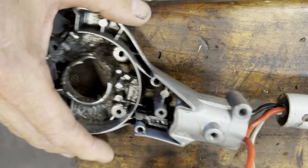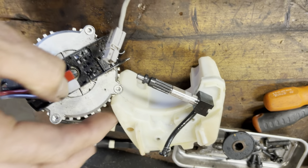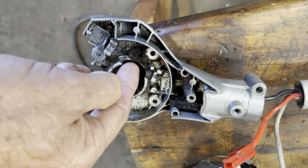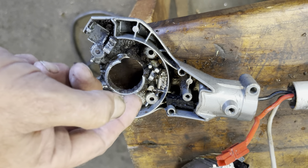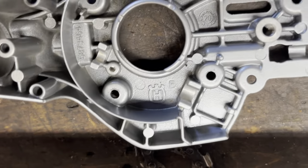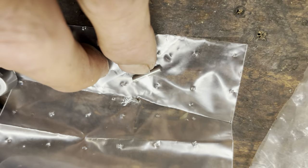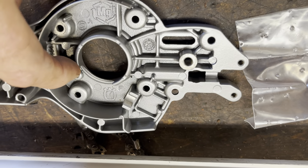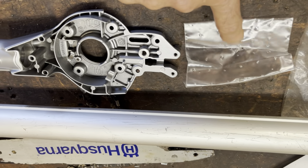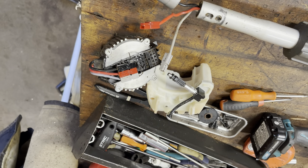This is the pin — it actually holds the worm gear in place right there. It's stationary while the worm gear itself turns and pumps oil. That's how the housing comes, and in a little baggie there's this pin which is a super tight interference fit. I found that heating the magnesium housing and letting it expand, then tapping the pin in, does a really good job.